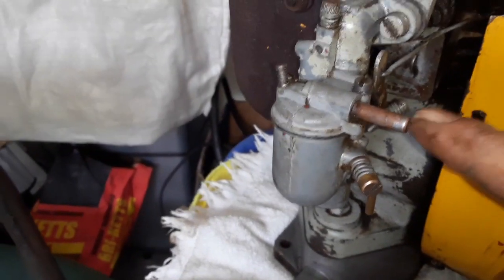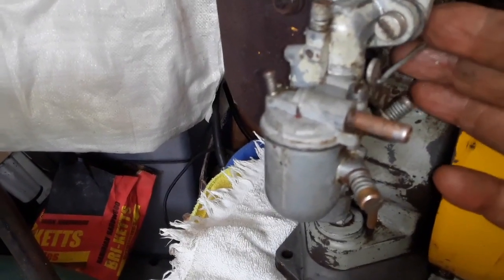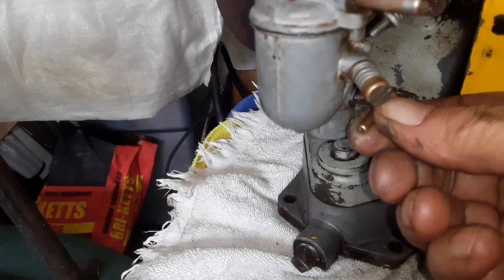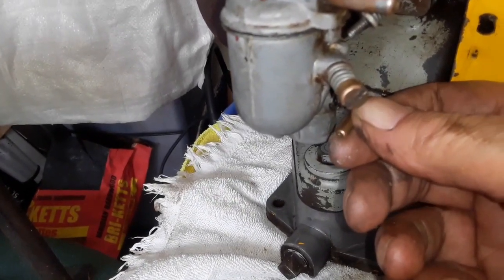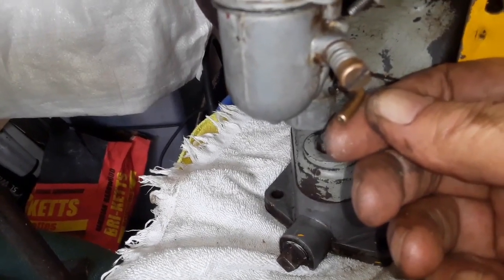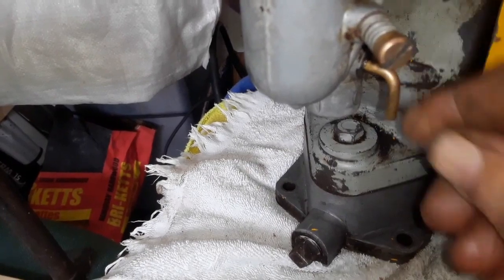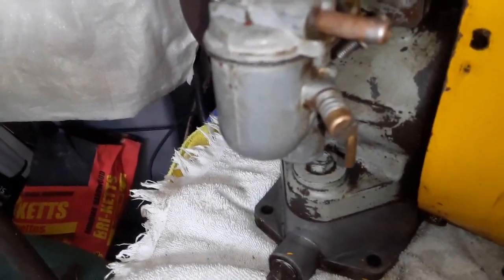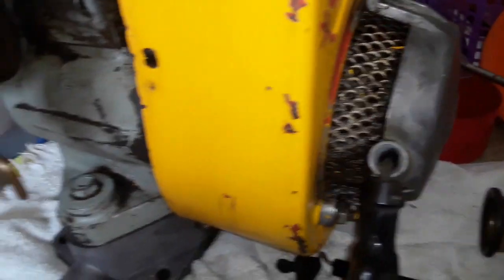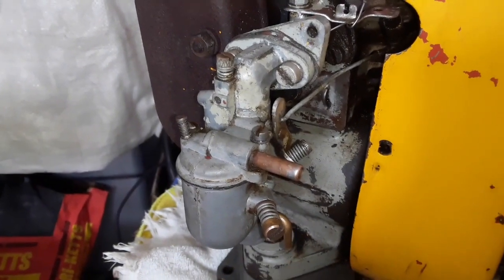Okay, guys, carburetor is back. And just to confirm, this is the throttle and that is the choke. So on this point, it is choke open, meaning it won't want to start. So you put it on this to get fuel and then you put it like that. Okay, so now I'm quickly going to remove the pull start and then we can start and bottle feed the baby.